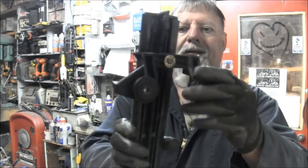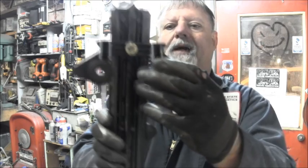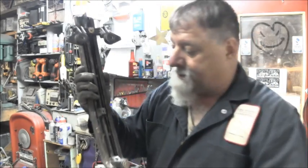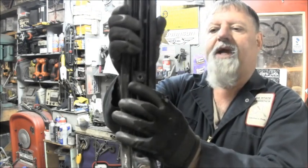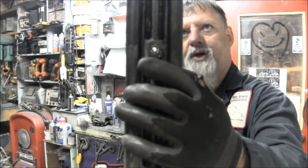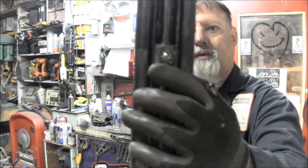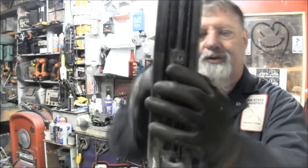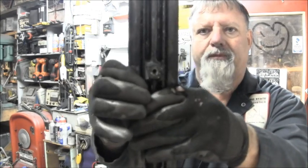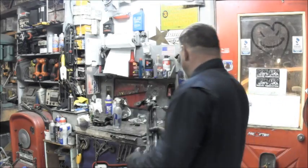And there's the bracket, and that tightens up against there, and then those two holes there bolt to the power head. Well, then I went to take this one out in true salty, abused outboard fashion. The bolt snapped off. So I just drilled a hole all the way through it. There's a little hole there. I'll just put a bolt through that, and it'll do the same thing.